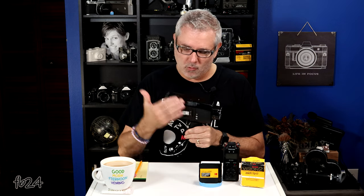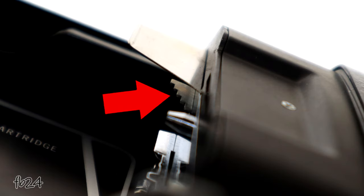This particular camera has a UV filter screwed onto the front of the lens. If you don't use a UV filter on your cameras, you probably should — if for no other reason, it just protects the glass. This camera has the ability to properly meter film at ASA ranges from 25 up to 400 ASA, or ISO as we call it now. It has a sort of funky little shroud in the front — a kind of cover that protects the little staircase meter system inside the camera. Once you pop the cartridge in, the camera automatically knows what film speed to set and does so automatically. A lot of cameras do that, but many only go from 25 or 40 up to about 160. This one has a much wider range.